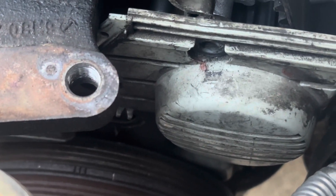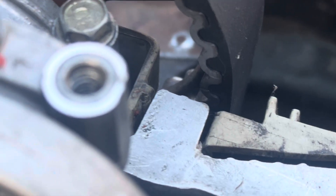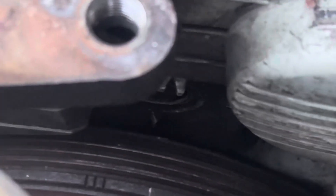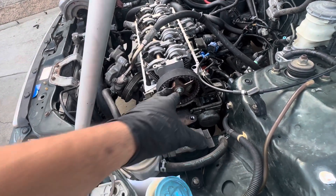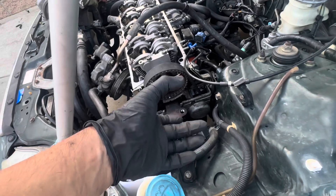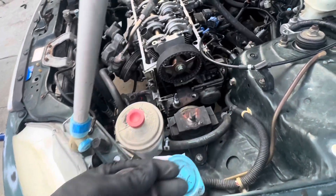The timing is about on there. Behind the cam gear, if you can tell, there's a mark — the cam gear has those two timing marks and that's on top dead center. Down there is also pretty much on it — you can see the white line with the little arrow. I'll be taking the timing cover off, loosening the bolt for the tensioner, and slipping it off because the little gear on the bottom has to come off so I can put this little spacer — or washer, whatever you want to call it — on there. Let's go ahead and take that apart and do it before the sun goes down.